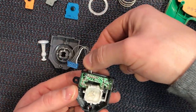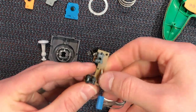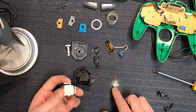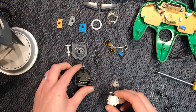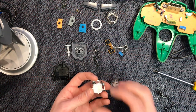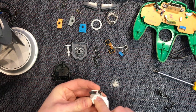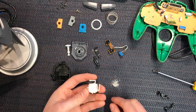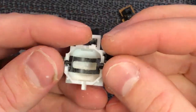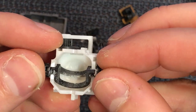The circuit board will just lift right out, so you don't need to get that wet. Those are the little sensors that sense the gear rotation. Don't drop it like I did. We need to look at what's actually wearing away to help determine how to repair this. I'll give this bowl a little wipe out before washing it just to see what's going on. Refit the large gear and have a quick look — you can see there's a huge gap underneath that bowl, meaning a lot of that plastic has been worn away.